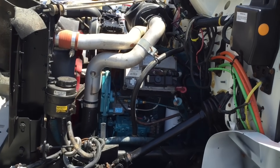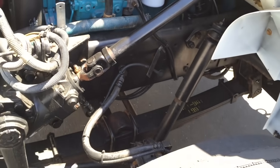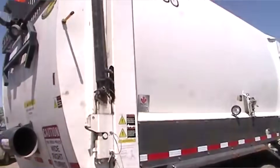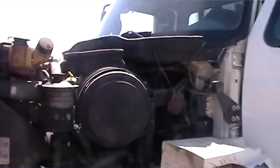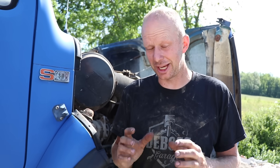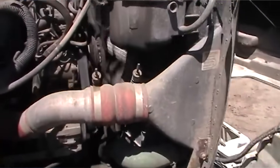Whether that was true or a fluke, that's what the techs were told and what the end diagnosis was for the customer. After that the E's got a really bad name in the shop for being the engine that can't even have pumped oil go in. We had a bunch of these in garbage trucks, and the garbage trucks were in horrible, raunchy conditions. A tiny bit of corrosion on one plug somewhere would shut the whole truck down. So at that point they said: if you can find a mechanical pump, keep that truck on the road as long as you possibly can. Not that mechanically it was a bad engine — it's still a good stout engine — but the system to get it running and keep the emissions in line was a giant pain in the ass. I left the shop in the early 2000s and that was the main complaint about the E's up until I left.